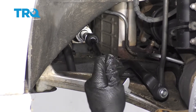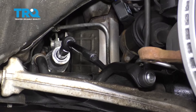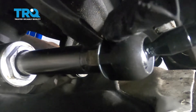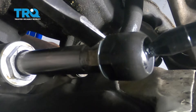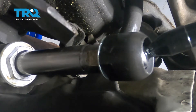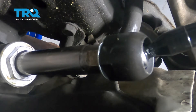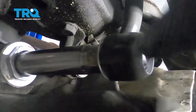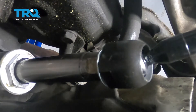Slide that apart. Now, from underneath the car, I'm just gonna take a pry bar — I just need to pin this washer over a little bit where one of the flat ends is, right there. Give it a tap with a hammer, and a little bit more. That looks good. I'll do one more on the other side. You don't have to do all four corners, but just do a couple — that is gonna prevent it from loosening up.